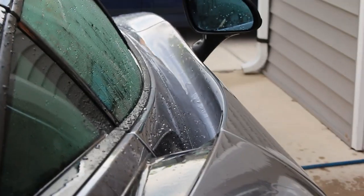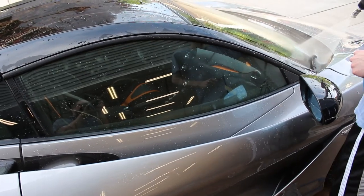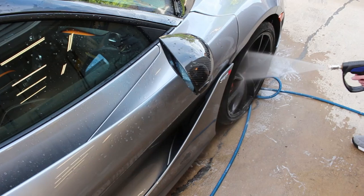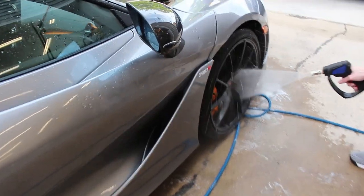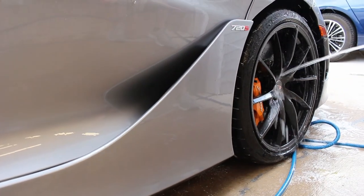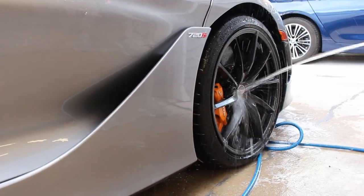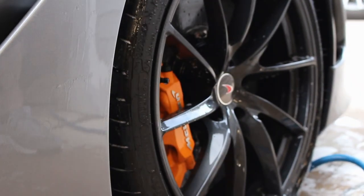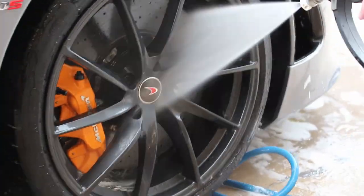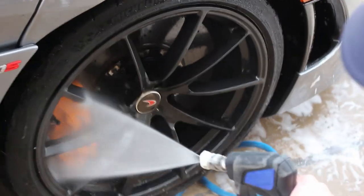All the water is extremely flat because there's no protection, there's no wax, and all of that makes a situation where when we get those bugs on the front, they stick way more to the car and they're way more difficult to remove. It's important to note that clear bra acts like paint, so clear bra is even more porous. It's softer than paint. Paint is harder. So when there's no protection and that bug hits it, it sticks and digs into the film,